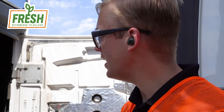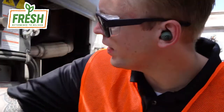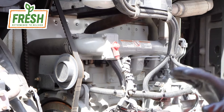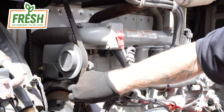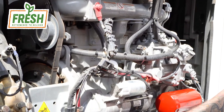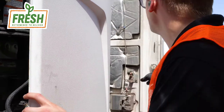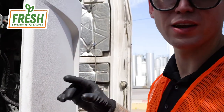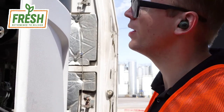While inside the unit, check for any frayed electrical wires. Check your hoses for any cracks, tears, or leaks. Check your belts for any signs of abnormal wear or excessive free play — make sure they're not cracked or torn anywhere. Inspect your fluid levels; make sure your oil is between the safe hashes on the dipstick. Make sure you also have proper coolant in the overflow tank to keep your unit cool while it's operating.